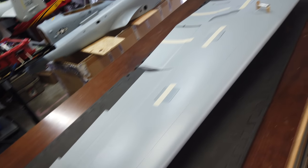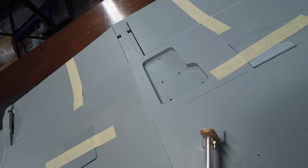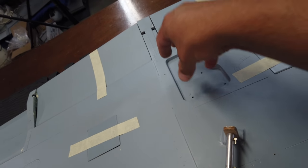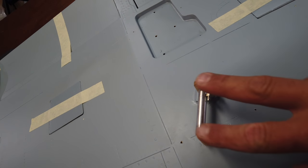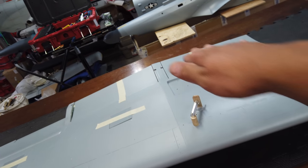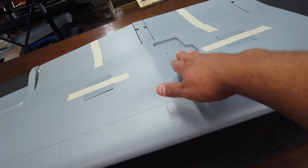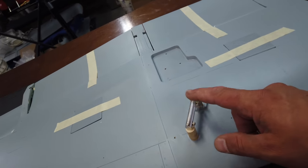It is time to start on the wings. We've got the left wing on the table. The gear only goes in one way - the cutout only fits one gear - so there's not much to figure out. The gear bolts on, and you can see the fairing piece that covers the gear is already pre-drilled. This cylinder right here is our lock for the gear. On very first production versions of this airplane, the gear would come up and hard dives would make it fall down, because it's only held up by air. Now this is sequenced as a lock.